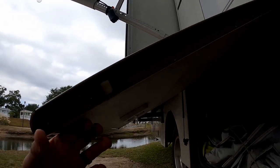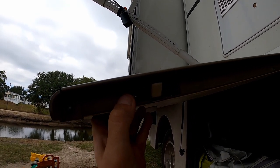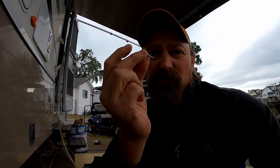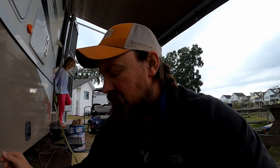Hey, what's going on, everybody? I'm doing a quick little repair on our 2008 Winnebago Sightseer compartment doors. They have these plastic plunge latches, which is right here. And you can see this is the new one. I actually broke this off, and then I got a replacement. But the replacement came with screws, but you need to use rivets to get it to actually work properly.